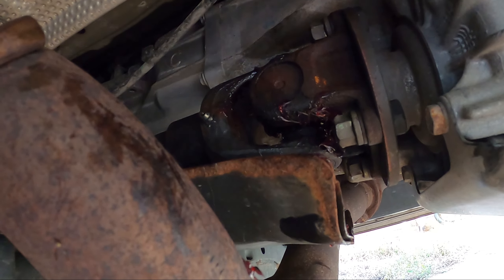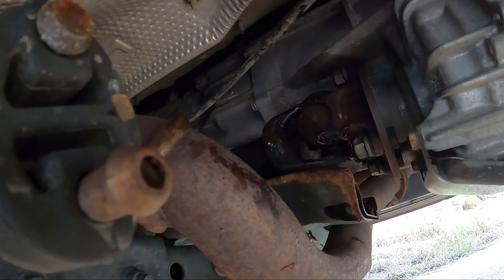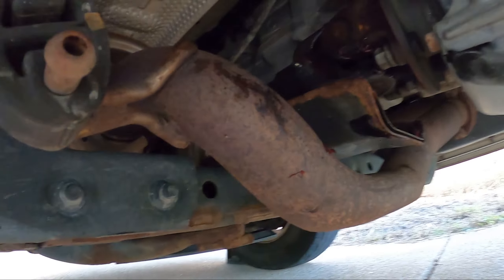You see how there's some grease on there? I couldn't fully get it off, so instead of shoving a rag up in there I just used my fingers to try to get it all out. Yeah, you're going to get it on the exhaust and you might see some smoke, but that's no big deal. I hope this video helped. If it doesn't get rid of the clunk, go for a drive and if it still didn't, do the main grease fitting — the one with the moly — that's going to be the majority of your clunk. Give it a couple more pumps and take it for another drive until it goes away. You don't want to overload it because that will cause damage to the driveshaft.